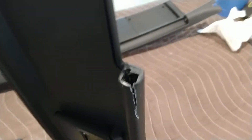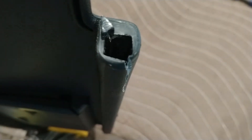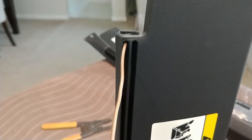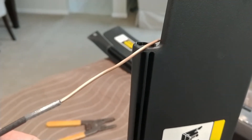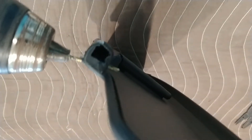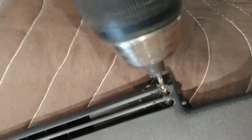In drilling, I take my bit and work from the slot through to this portion on the sun visor — lowest part. Now I'm going to show you with my wire, but when I start to drill, I want to come to this slot farthest outside of the sun visor. You're going to start your drill bit as low as you can, and when you bring your drill bit through, you want it to just come out this side of the sun visor. Here's the piece drilled — still has a drill bit in it. You can see the way I've angled it so that it is just on the outside edge inside the sun visor, and I started the bit right on that outside slot. It goes all the way through.